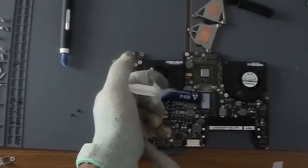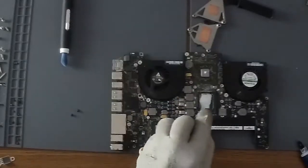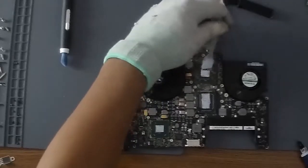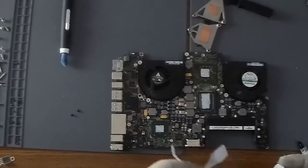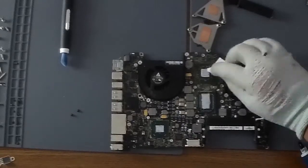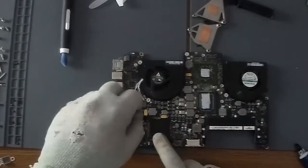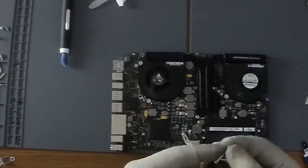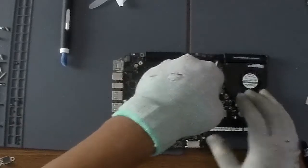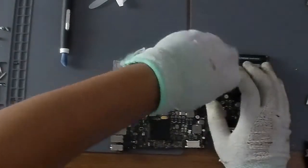This method of applying thermal paste with a spudger spreader is new for me. I usually put a tiny dot, but after reading research on the best way to apply thermal paste, the differences in temperatures are negligible between methods. I wanted to make sure whatever I put on doesn't overflow, so I use an exact amount with the spreader. I was careful not to introduce air pockets — the only way to see those is through a microscopic lens, which I don't have. When putting back the screws, you have to put them in a zigzag fashion so pressure is evenly distributed across the dies; otherwise you risk cracking them.